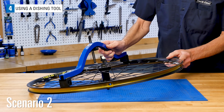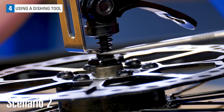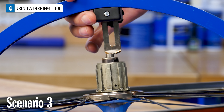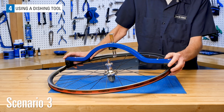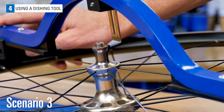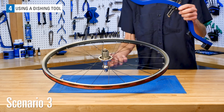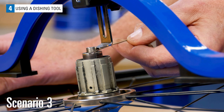Here is another measuring test if the wheel uses threaded axles. A threaded axle is commonly a one millimeter pitch. We can see about three threads here between the indicator and the lock nut face, so we have about a three millimeter gap. This rear wheel will demonstrate the third possible scenario. After setting the tool on the right side of the wheel, flip the wheel to compare the three contact points to the other side. Here, when the tool is arranged so both feet are placed on the rim, the indicator sits below the lock nut face. If the difference between the indicator and face is within one millimeter, it should be considered within tolerance. To get a gap you can measure more easily, reset the dishing tool using the left side as the beginning reference side. With this flip of the wheel back to the right side, you will find a gap between the indicator and the axle end face. Our scrap piece of cable indicates this wheel needs correction.